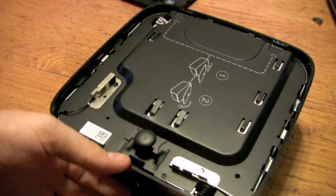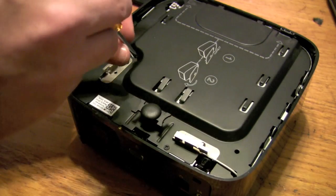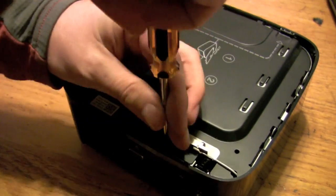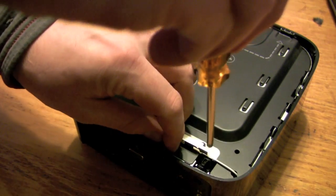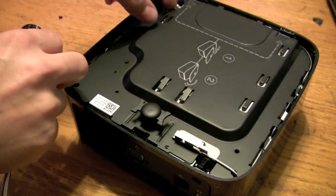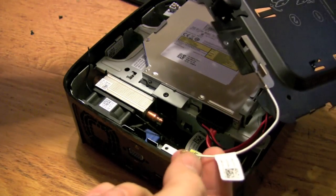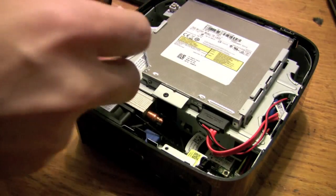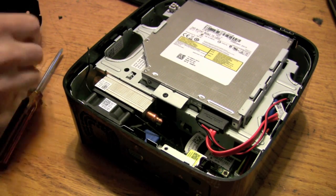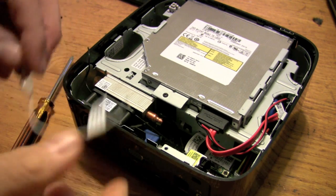If you've got WiFi, the antennas are going to be clipped here. You can see how the antenna wires route through these tiny little cutouts on the corners. So basically there are three screws here to undo, one in the back. These actually don't hold it down, so if you're careful you could just leave those on. The WiFi card is on the bottom here. It's easier once you're in there to screw the antenna on at the top, since the WiFi clips are so small.